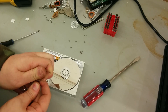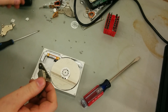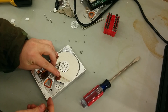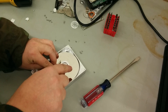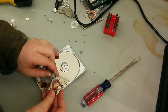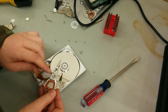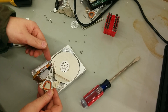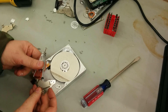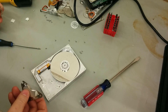On these particular drives there's also a third magnet — a very, very small one. I'm not even sure if this is a neodymium magnet. What they use it for is when you turn off the drive the head will get parked. These drives park the heads in the middle of the disc, so when the drive spins down the heads slowly land onto the surface. This other magnet holds the head in position so that if the drive takes a sudden shock when it's off, the head doesn't move — it stays stationary in its parked location. I'm not going to bother recovering that one since it's so small.